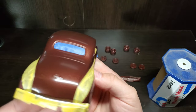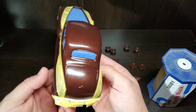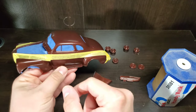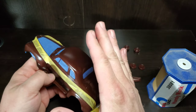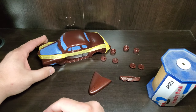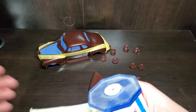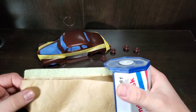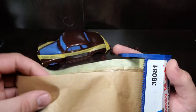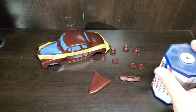Here we are with our two-tone masking outline done, all done with Tamiya masking tape - some really great tape for scale models. Super thin, low tack, won't bleed as long as you don't flood it. One thing I'd note: this is my first time doing a bubble fender car in a two-tone. On any others I do from now on I would do the top color and then the sides as the second color. But with 20 years of doing full-scale automotive painting I've always done it this way so the paper can hang down the sides. I really like these USC Handy Masks - they come pre-taped and unfold six or seven inches on the sides.